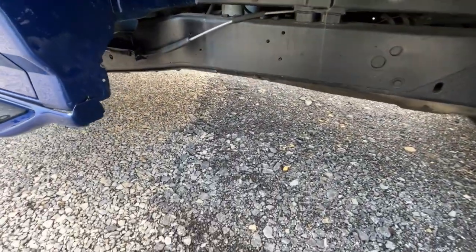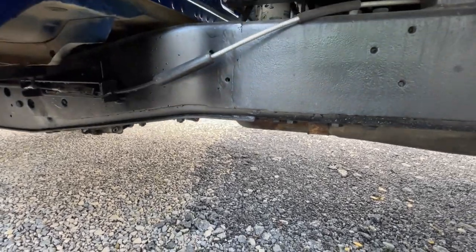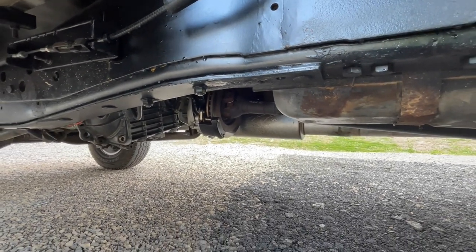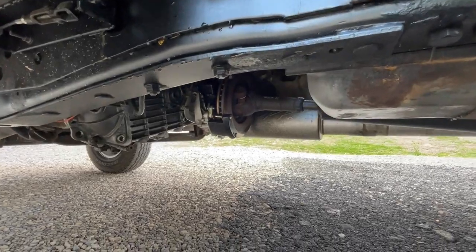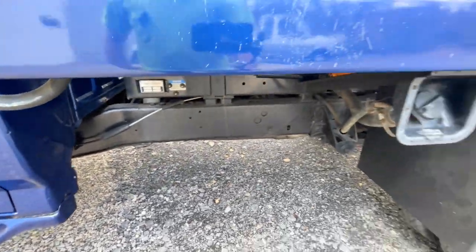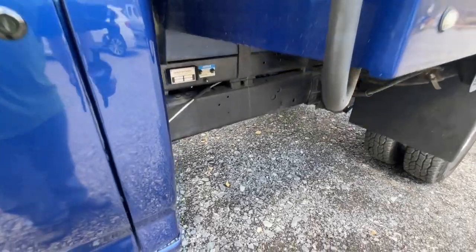The Quigley setup comes with an adapter for the parking brake, but the factory parking brake was causing issues — vibrating, pushing fluid out, just problems upon problems. So I designed and installed my own disc brake setup on the back of the transfer case. Now we don't have to worry about the drum brake setup screwing up, and those are $1,200 to find rebuilt.